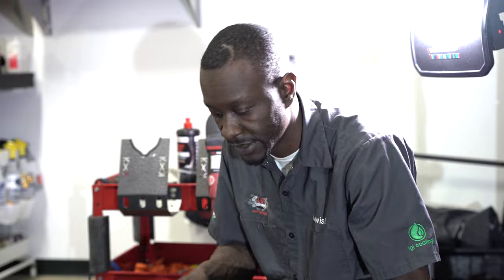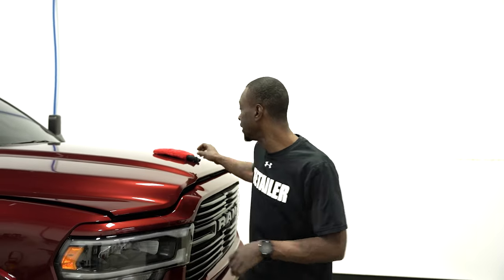Here at ADS, the way we like to prepare for ceramic coating is after every correction we bring the vehicle back into the wash bay and do what we call a ceramic preparation wash. Within that wash we use a foam cannon and a Carpro Softy series mitt — a very soft mitt. There's no scrubbing; we're just dragging and agitating the wash solution on the surface to lift any polishing dust, polishing oils, and greases left over from the paint correction cycle, to prepare the surface to fully bond to the ceramic coating.